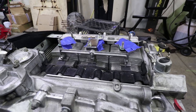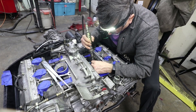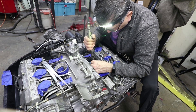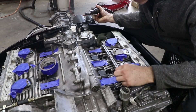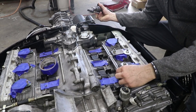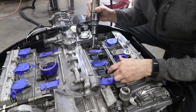It's an undersized drill bit, but it's a good way to get the pilot hole started so we can open it up for a tap. I added this clamp because this side was flopping up and down a little bit, so this is even better than before — it really secures it in the middle and on the ends. I'm still drilling this one and I'll move over to the next one.